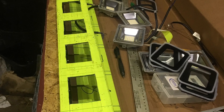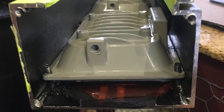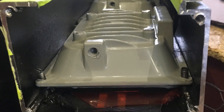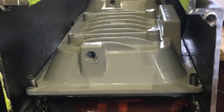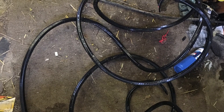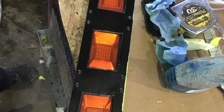They're all sealed in with silicone — it's completely waterproof. I may end up putting it on top of the roof of the truck at some point instead. They just barely fit inside the enclosure, but they fit well, and they're all held in with a bunch of M4 metric screws. There are 10 lights, but the controller only controls 8 lamp circuits, so I decided to combine the outside two lights. I had to create a custom wiring harness for this — I needed 9 circuits, and ended up adding 14 circuits to the truck, so I have some spares for the next project.